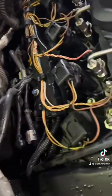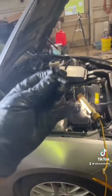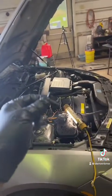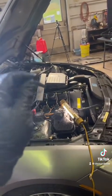The code I was reading for the boost is apparently the boost solenoid, so I'm going to take a look in here. Maybe I shouldn't be too surprised I have a boost issue — there's a right-angle vacuum line piece that did not go back into the car, so I'm not sure where that goes. Maybe that's it.